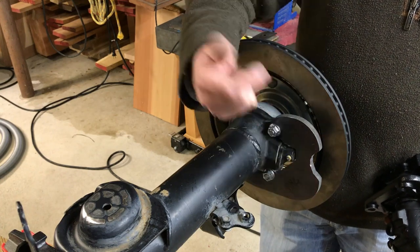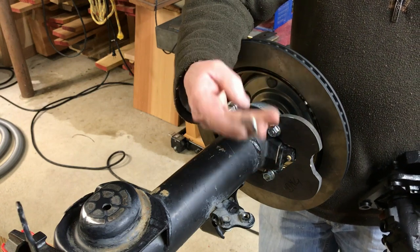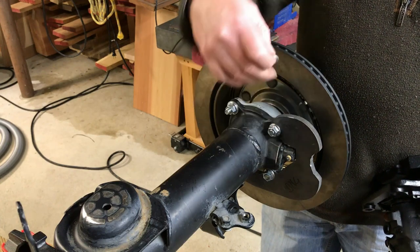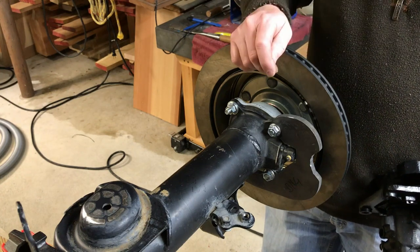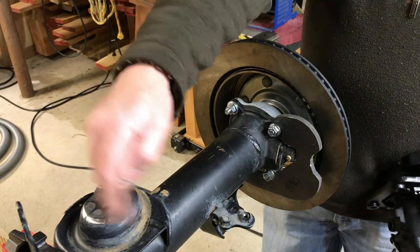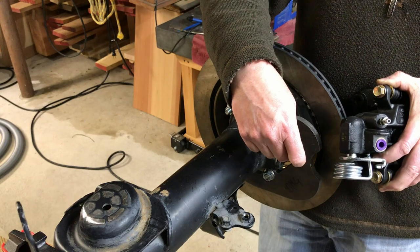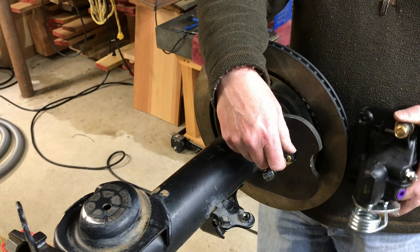I'm going to get the holes drilled, grind away a couple of the M12 washers about halfway, get these guys rattle-canned up, and then go through assembly. The next step is really just going through what I did for the brake lines. I'm not going to deviate — I'll just run the stock brake lines down here. I will have to do a custom flare to the banjo fitting that goes on the back of this Ford caliper. For the e-brake, I think I'm just going to order the cables.